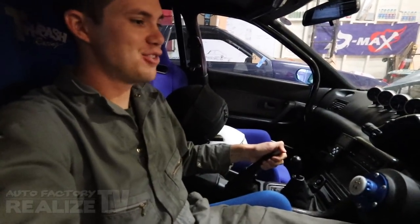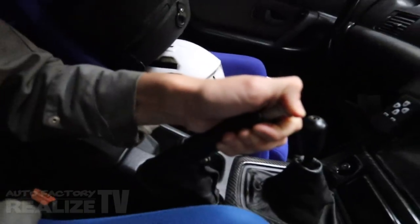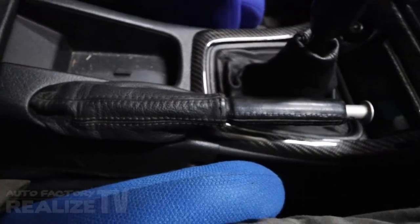One of the reasons for breaking axles that a couple of my friends have been accusing me of is they think I've just been on the handbrake, yanking it like no other, and then dumping the clutch with the handbrake still up. I got a news flash for you — that's a stock handbrake with stock cables. It's the stock drum handbrake and the pads are from 1989. This thing locks up like half the time to begin with. I've got my doubts that this handbrake is keeping the wheels from spinning and putting the power all onto the axles.